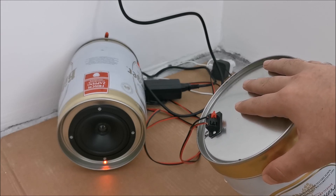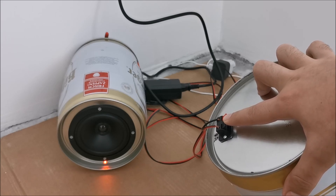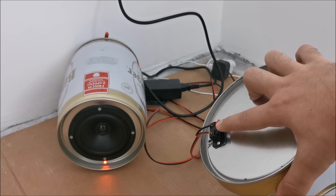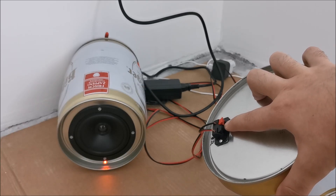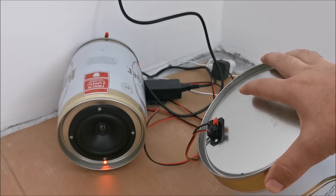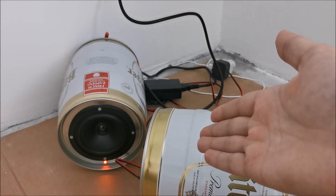I will open them up — either I messed up in the wiring or the instructions have something wrong in them for the module I'm using. The idea is to make sure you can test if something like this is the problem: simply reverse the wires in yours and that should be about it. If they sound much fuller and with more bass, yep, you had a wrong polarity — it's a kind of AC with a certain frequency depending on what you are playing. Many people don't know about this and they have two speakers and say, wires, let's connect them, whatever goes where, who cares — yes, it actually does matter.